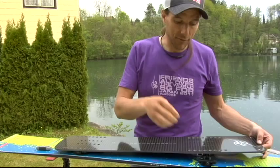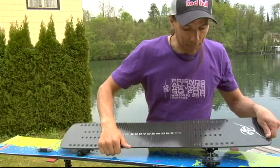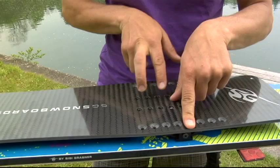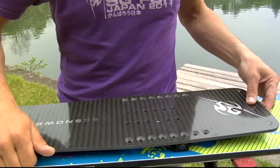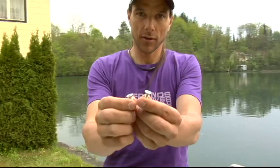In general we use one of these two — like the second or the third. We check the axle here and choose these inserts, because here is the center of the bracket. We're going to use this insert pattern — this one is three centimeters behind, this one is five centimeters behind. If you want to go even further back, we can shift the plate, giving us three, five, or seven centimeters behind. I'm trying this variation now, and with these screws I'm fixing the plate to the brackets.